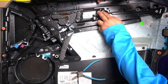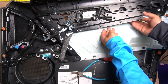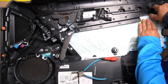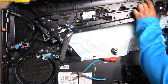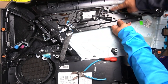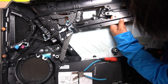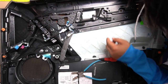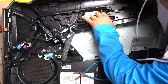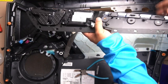Once you pry this apart, you'll be able to remove it easily because it's just sitting in here. To remove it, lift this one up and you'll see where it's connected. There is a push clip here — it clips over the top. Release that, lift it up, and it will separate. Then you'll see a tab here and a tab here. Push down on that, reach from the bottom and separate this piece. Pull it down and out — and now this piece comes out. That's how you remove this piece.